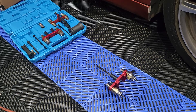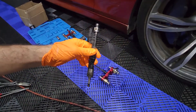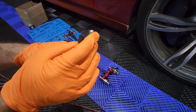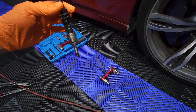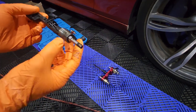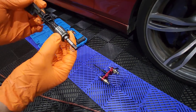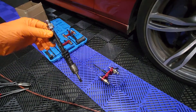So how does the fuel injector on a BMW S63 engine look? The fuel injector looks something like this. As you can see, this is where the fuel line connects right here — it's a threaded tip — and the fuel injector goes all the way through the valve cover to the combustion chamber. These injectors sometimes get stuck; generally speaking you could pull them out and they'll just come out, but sometimes they get stuck with heat. You can see this one has its ring damaged and has some oil on it too. To pull those out you're going to have to use a puller tool that BMW recommends.